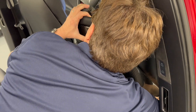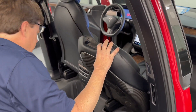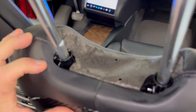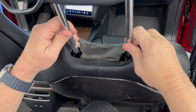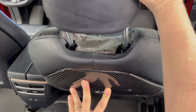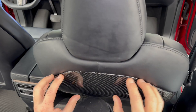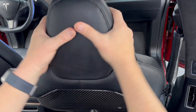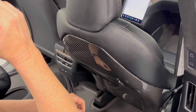Now we're going to tilt the seat back — this will be the easiest part. Putting the original headrest in. We have to be gentle and careful. The headrest has the two clips here. We're going to slide the headrest down slowly through the plastic alignment inside tabs. Go nice and slow — if you go slow, you know you're lined up. Then just push the headrest down and you'll see the seat back actually grab and pinch right up to it. The pins are locked. Look at that — it's perfect. It's all in and set. You can pull up on the headrest; they won't come loose. Look at the tight fitment, the side angle — look at how great it fits.